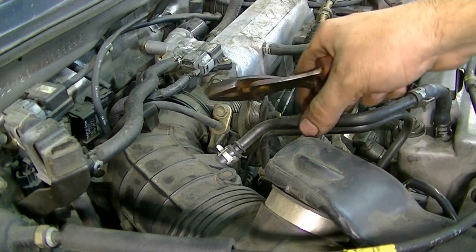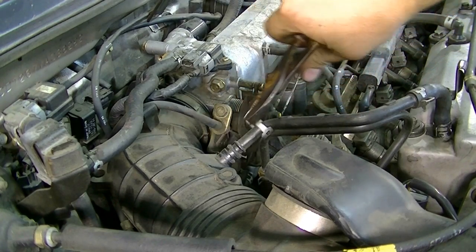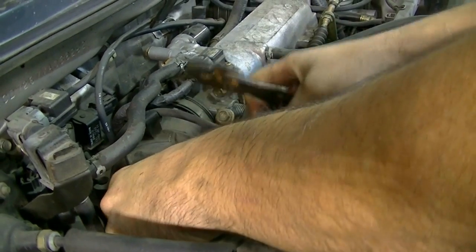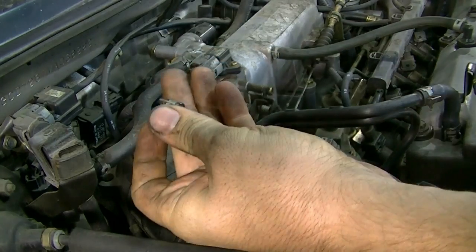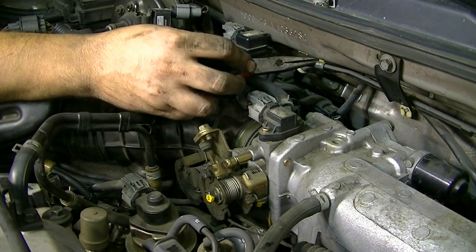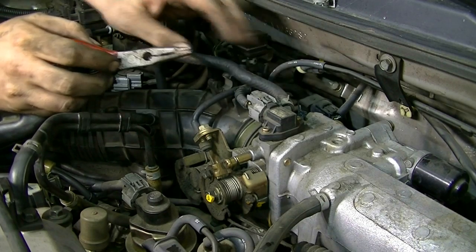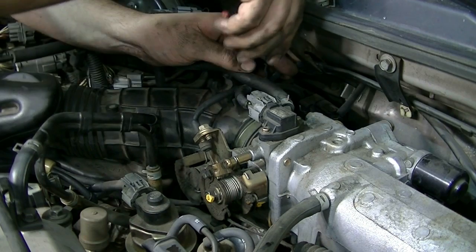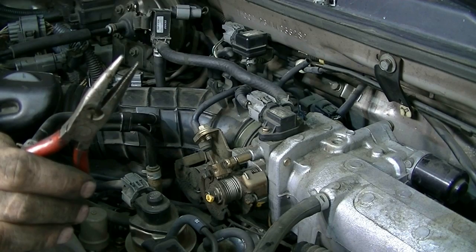What we're going to do next is to remove this air tube that comes from our PCV valve. Save this clamp. What you want to do next is to disconnect this vacuum line — this also attaches to your air tube, so it's coming out with your air tube. An easy way to do this is just to get a pair of needle nose pliers and twist it slightly and then pull on it and it will come out.